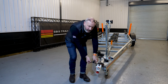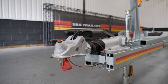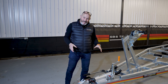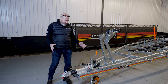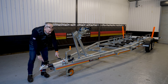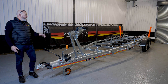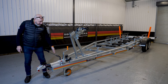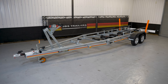All our Cast Alko coupling heads come with an integrated lock. It's a great first-level security lock for short stays, service stations, that sort of thing. It's integrated into the coupling head so you can't forget it or lose it. As you couple onto the ball, the handle is down to show the ball is engaged, and the little indicator has popped up from red to green. The lock is simply a key-operated push-fit lock — give it half a turn, pull the key out, and now it's locked. A great simple thing for a bit of security when you're traveling.